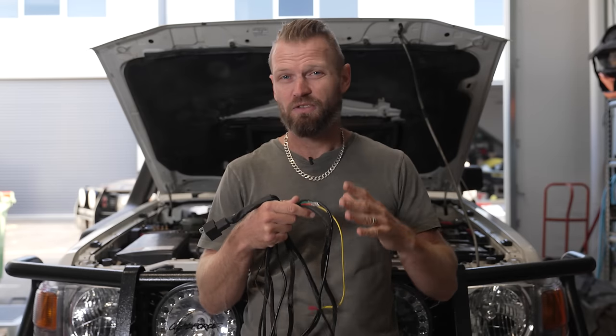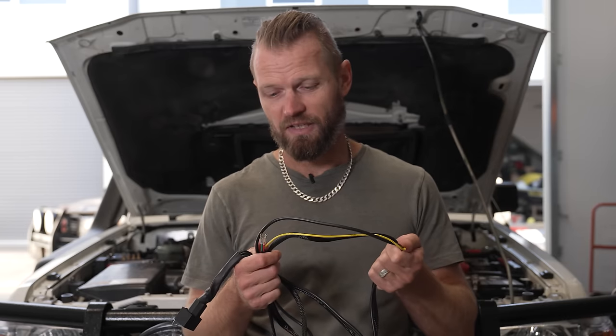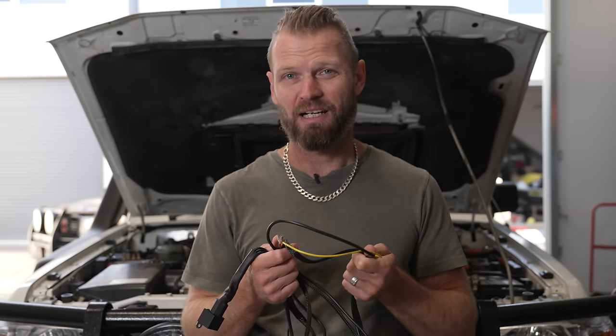My final tip: take your time. Shape everything, shorten wires where you don't need really long bits — you don't want coiled-up excess wire. Use proper extender wires and definitely heat shrink and solder. Don't twist and tape, don't cut corners, because in the long run you're going to end up with a vehicle fire. I've seen that happen to someone else numerous times — no names mentioned.